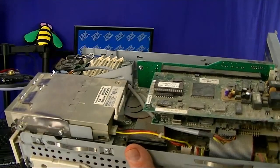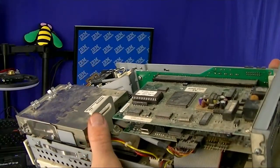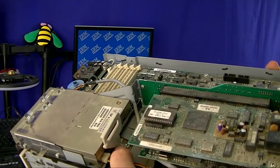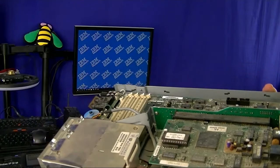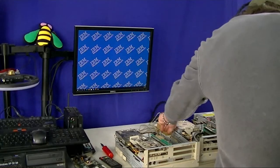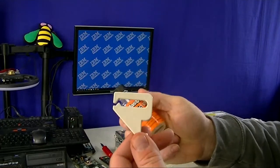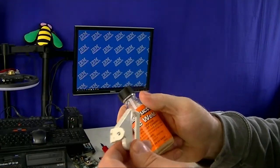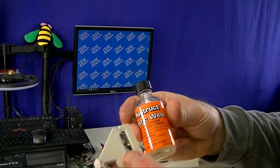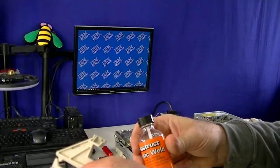But you see these plastics, and that plastic here, that's for the power supply connector. It's a strain relief. But you're starting to see these plastics are cracking. And I went through on this, and I pulled out my plastic glue. And at least for this level, I don't know, I'm not really a chemical guy on my plastics, the polycarbonate or whatever they normally use, but at least for these plastics, it's a later generation, it's able to be glued. So I've gone through and I've glued that assembly.